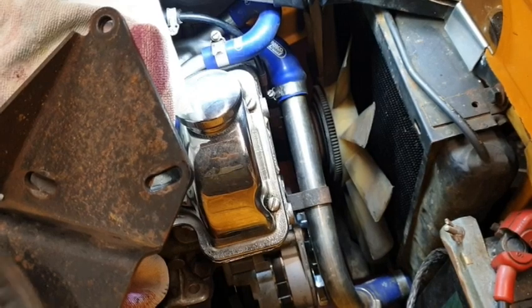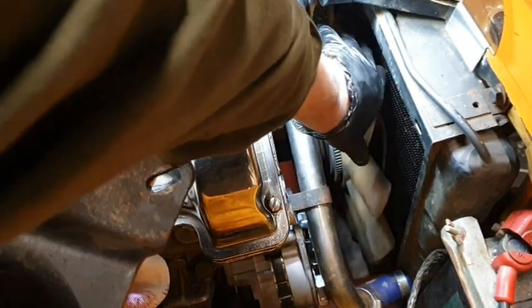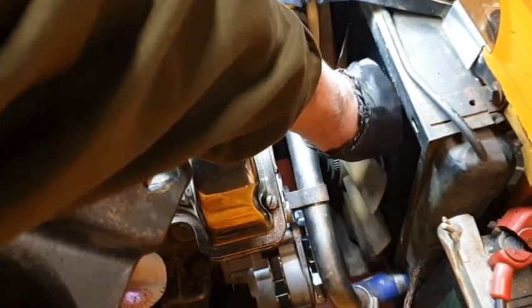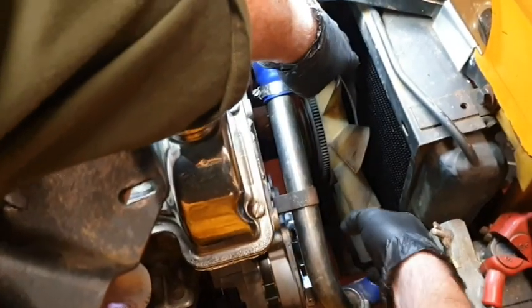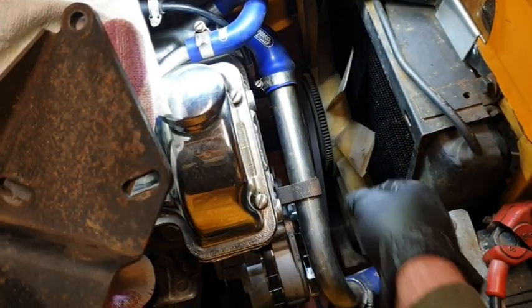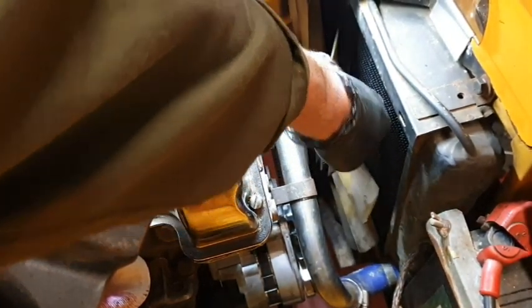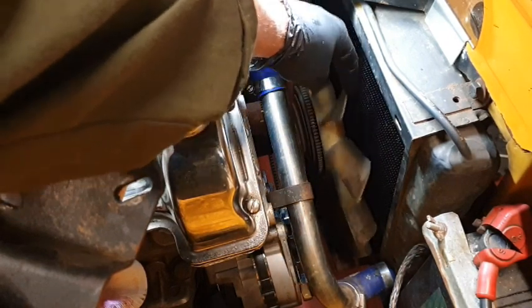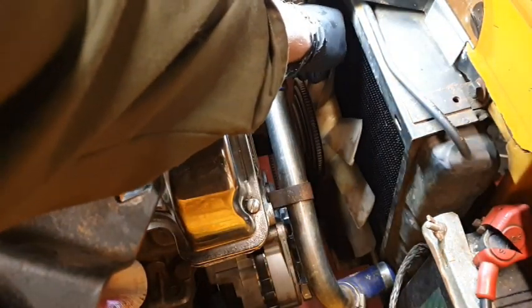Okay, wonderful. Nicely protected fan now. Okay, back up top again now, and I think it's time that we put the fan belt in place, just so that we don't forget about it. That'd be a bit silly, wouldn't it? There we go. She can hang just there. Right. Yep, that's good. One of the things to check as well, when you do a service, and ideal time, just do it now, is make sure there's no play in the viscous fan, and there's none.